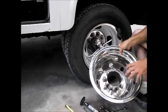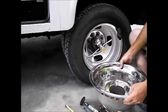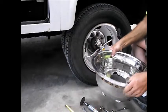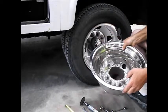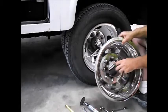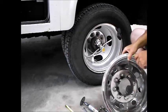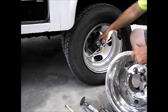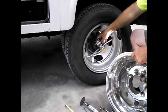If you're going to do a lot of these, what I would do is make yourself a height stop out of a piece of truck exhaust pipe so you can run your cut-off wheel down to that and around it without having to mark anything. Or you can make your height stop, set the cover on a lazy susan or turntable where it will spin, then use your plasma cutter — hook the ground on, run your plasma down to your stop, and spin it right around and you'll have it cut off in about 20 seconds. That way when you install it, the end of the hub is exposed and you can bolt your crossfire on in a good location. For the forward axle, this bolt will a lot of times be a 7/16 by 2, and you'll use a 7/16 flat washer, then still use the 5/8 nut as a spacer.